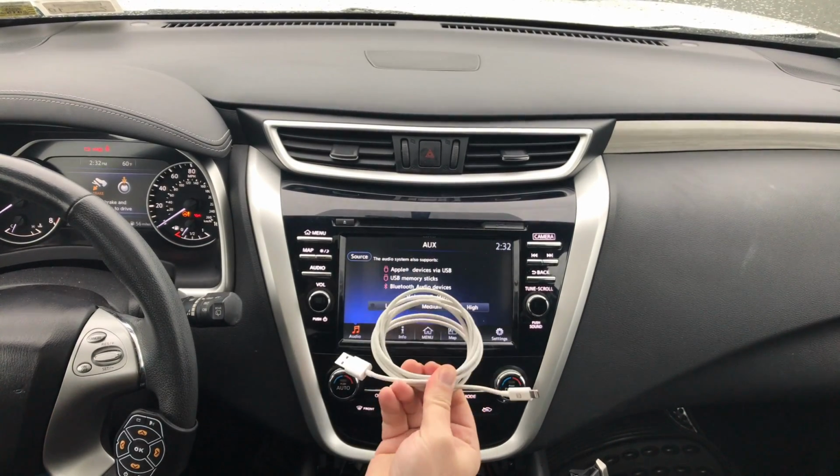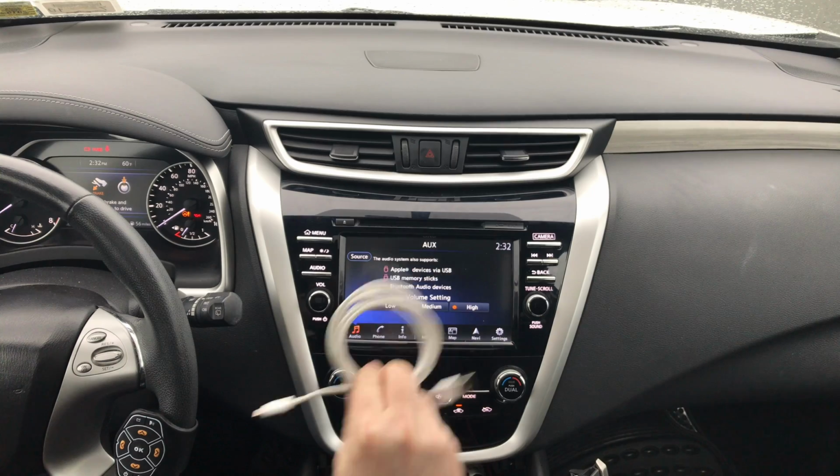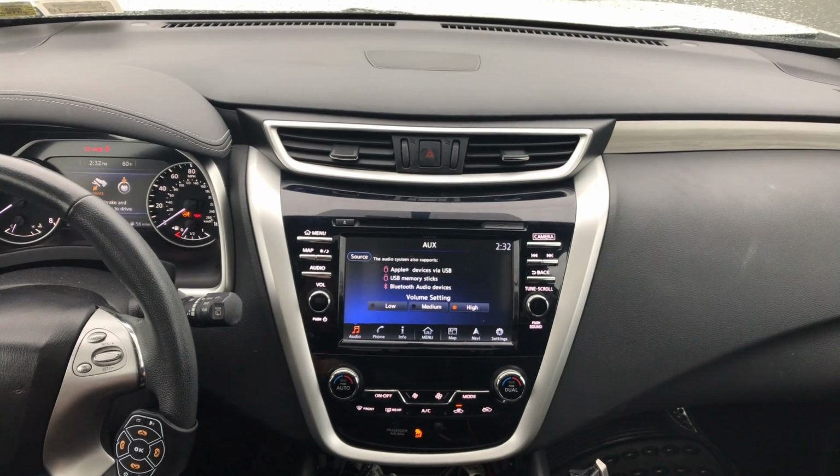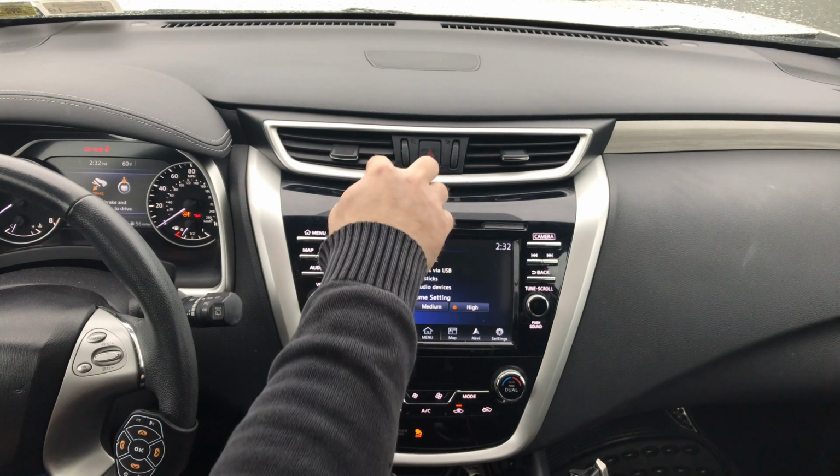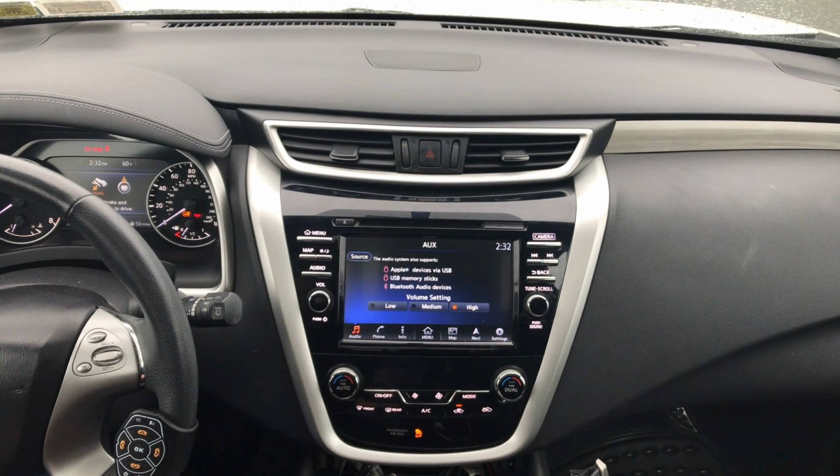Using a cable, the same cable used for charging the phone, you can buy a longer one. You're basically going to plug this cable into the interface, and you can route the cable from the back of the radio inside your armrest, so it's going to look like factory installed. Since you have everything open, you go from the back of the radio through the tunnel and into the center console, and you're going to plug into the phone.